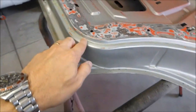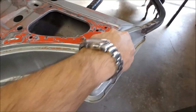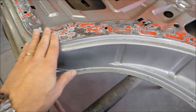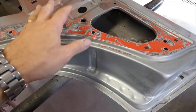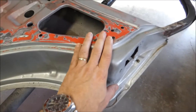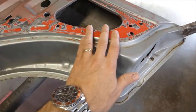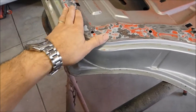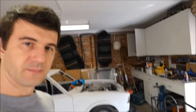There was some sort of fluid buildup going along there. You've got to sand that all off. There's multiple ways of getting the glue off. I could have done it with a wire wheel, but that removes everything and goes back to bare metal, which means you've got to lay on more material, which is either etch primer or whatever you've got to do. So if you've got good paint, there's no rust under it or anything like that, there's no reason to remove it, especially inside the jams. The only thing that goes on top of here is the door trim. So don't overdo the work in areas that aren't seen, but make sure that the work you do in those areas is protective work that protects the metal and the door so that it can last.